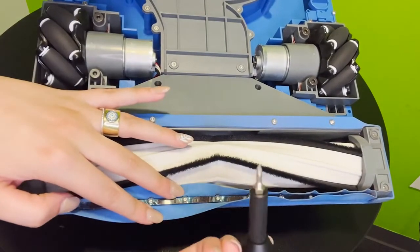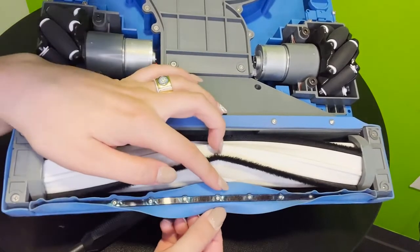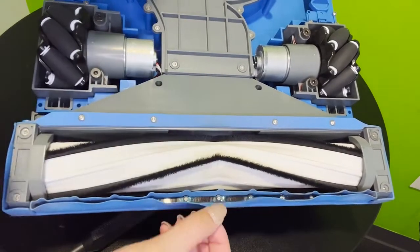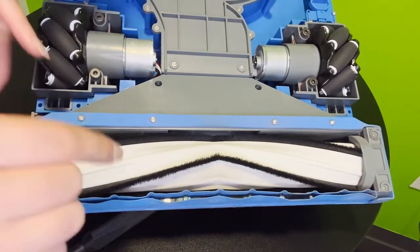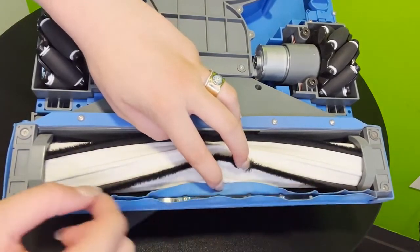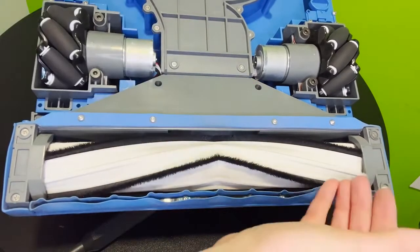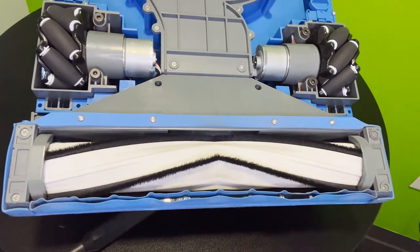And here, once you get your repair kit, all you need to do is pull back the skirt, remove those 11 screws, and remove the bracket, replace the skirt and or the bracket, whichever one needs it more, and then you can go in here and rescrew those 11 screws. So it is pretty straightforward. I'm not going to do it on the video because there are quite a few screws here and we don't want them to roll all over the place.